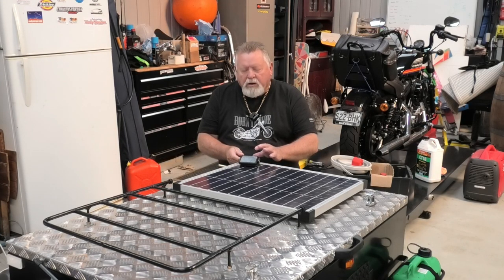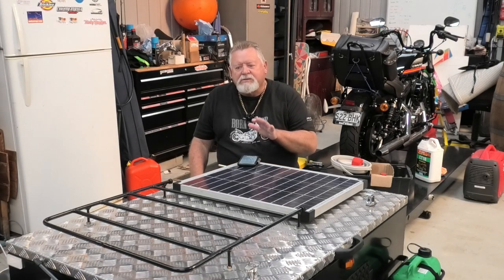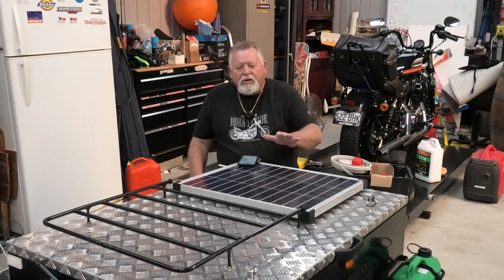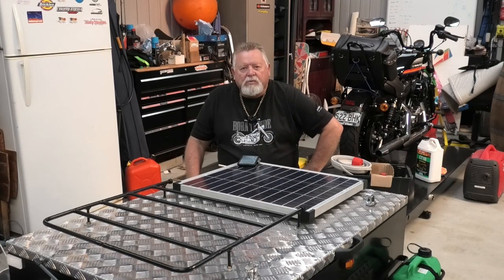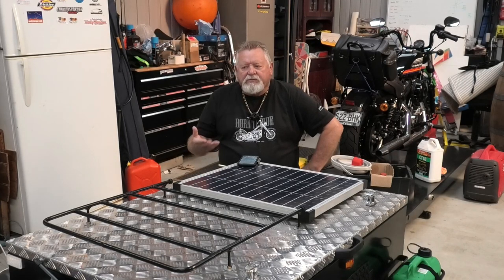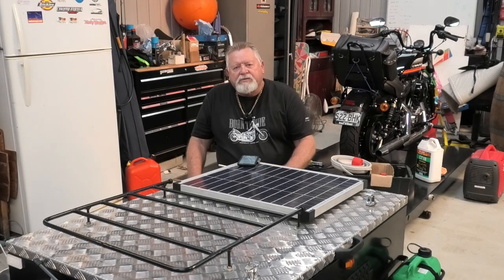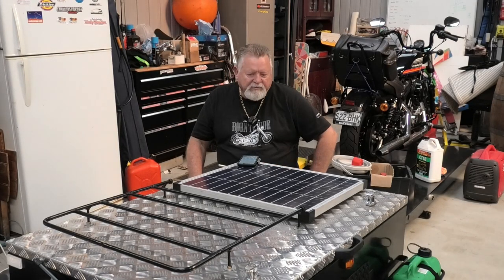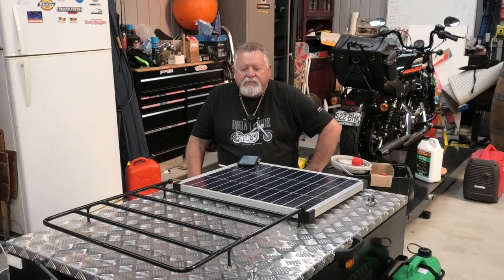Two, weigh everything that goes inside the trailer, that way you're not guessing or second guessing. All my gear inside the trailer has been weighed, and I've written with a permanent texta in a corner how much it weighs, so that when I'm putting it in, I've got an idea. I can go, right, I've got 60 kilos of gear and I'm towing 200 kilos. The reason for that is you don't want to exceed the manufacturer's recommendation for gross weight. I think this one's about 250 kilo. It's on the compliance plate. But just weigh everything.